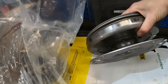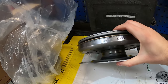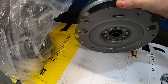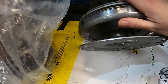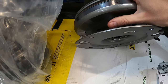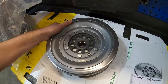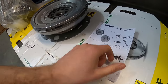The back part here looks a bit odd, looks a bit more like a flex plate. People always say with these LUK flywheels there's something wrong with theirs, but that's normal on these. This back plate here bolts onto the flywheel. You can see there's this big gap here - that's where the driveshaft runs that comes from the front diff and goes between both driveshaft flanges.